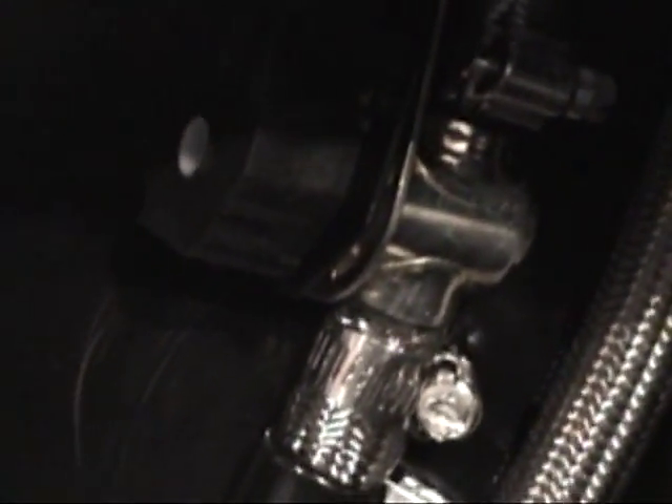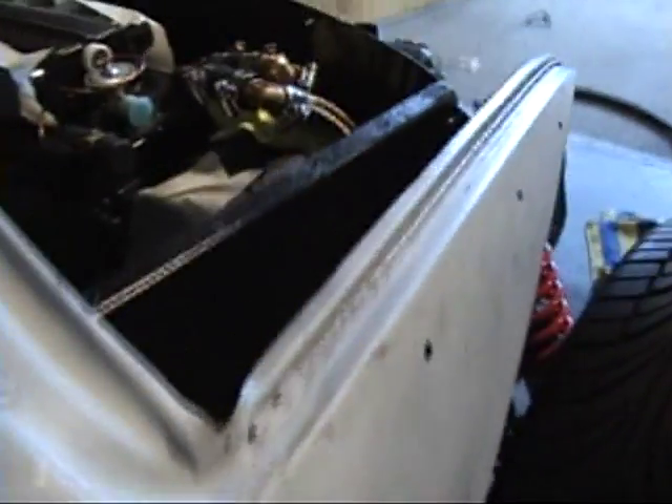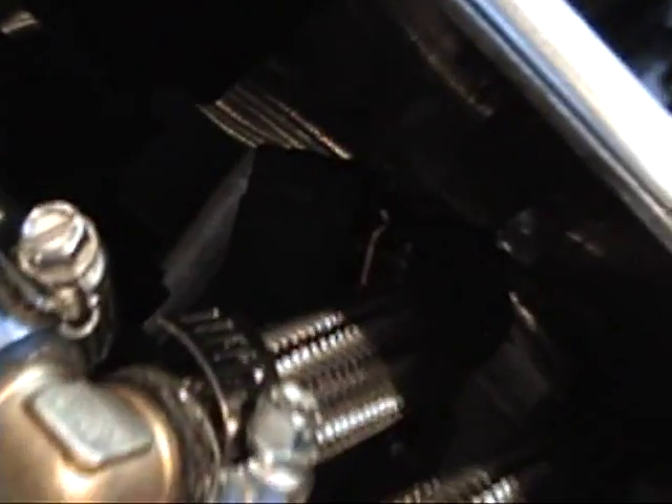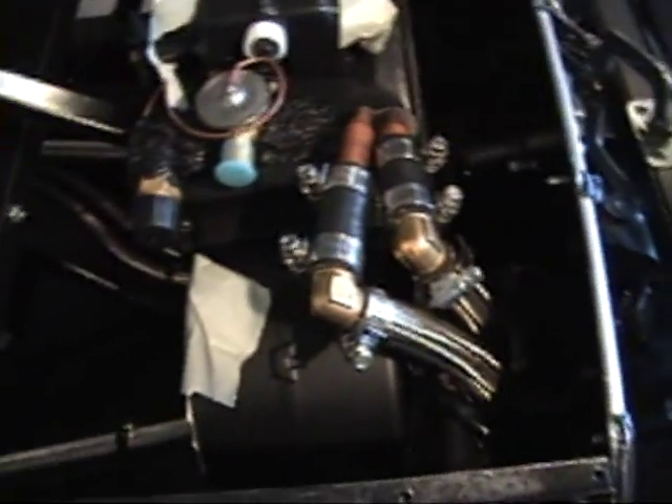Here are my lines again. They come off the engine there, go down through the frame here, they come across inside the frame, up the firewall. This is the inline switch for the heat — what this does is it controls the heat into the heater core, it either turns it on or turns it off, and it meters it a little bit or a whole lot if you want. Then there's the unit, and you come up across the back here, right up here, and then they tie into the heater core on the AC unit.